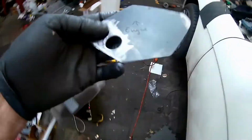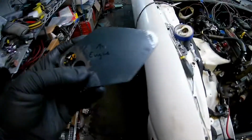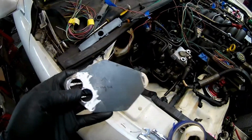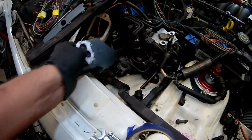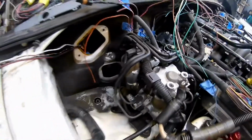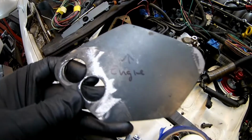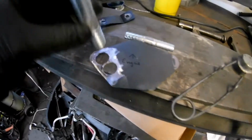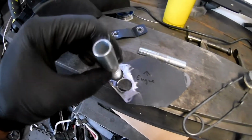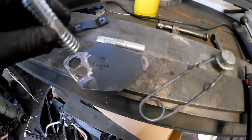You can buy these, actually, not in this exact shape, but there's a plate that I'm going to use to connect the fluids from inside to outside, so heater and sometimes the gas, but sometimes the fluid, the AC stuff. So that hole right there is the stock Lexus hole for the AC. I'm going to be able to stuff all of these through. So 2 1/2 inch. I know these look super close, but I'm going to be able to angle them a little bit to make that work. And then I have room over here to do the AC part of it.